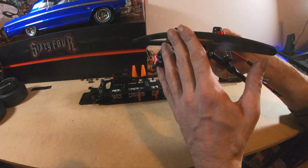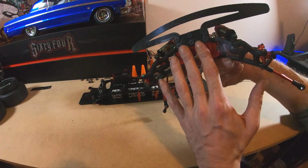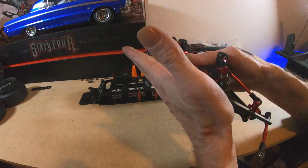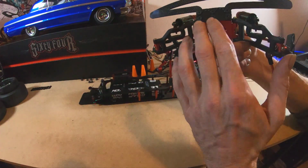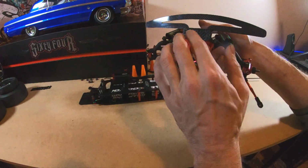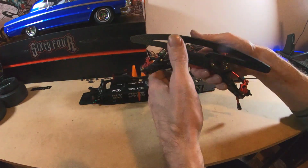So it's actually, while it's carbon fiber, so it's very, very rigid, the point that it's mounted to the aluminum is plastic. So we'll have a flex point and a break point for any little small bumps, and hopefully if anything does tear apart, it'll be that and not something else. Or if anything, that will eat up a lot of the energy of the crash that I have.